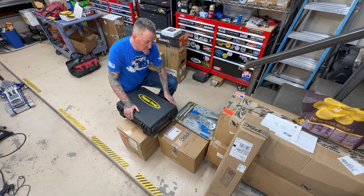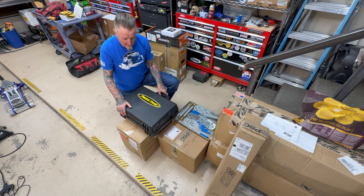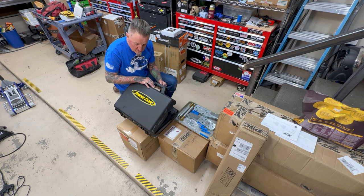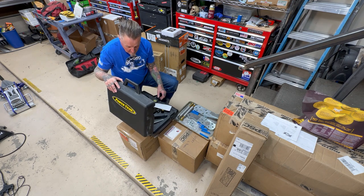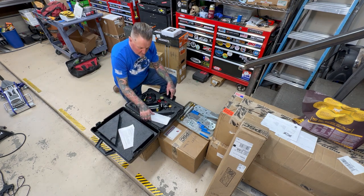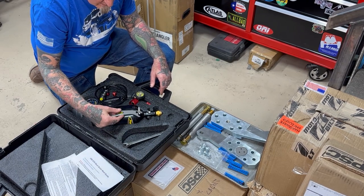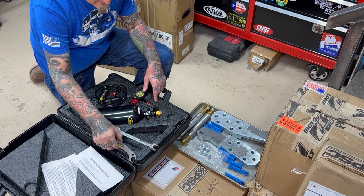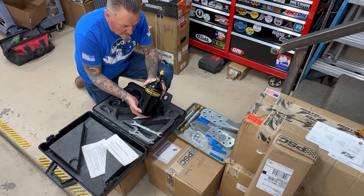We're going to bring them up to a higher pressure — hopefully it'll smooth out his ride a little bit. We're using a Power Tank kit, so I thought I'd show you what's in this kit. This video isn't really for people who know a lot about nitrogen-charged stuff — if you're familiar with it, this is pretty basic — but if you're new to these, it can be a little daunting. This kit is a single fill, not a dual fill. It comes with a wrench that does everything on your mother tank and your portable tank, but I like to use a thin 11/16th that lets me get in where I need to.